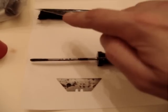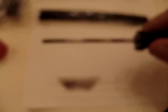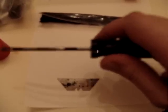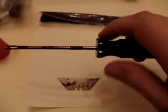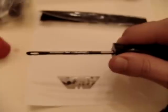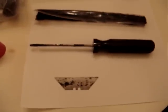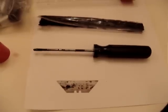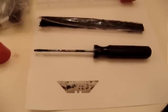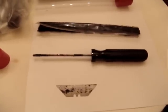What you do basically is stick one of these strips through the hole so it's equal on both sides. Once you've removed whatever caused the puncture in your tyre, you literally push that in there until the rubber's inside, then give it four complete twists, so you're twisting the rubber inside the hole. Then you pull it out about two inches or so, and with the blade you just cut off the excess. Although in the UK most shops won't install this for you because it's not actually allowed by trading standards, you can buy it as a home kit and it enables you to do the work yourself.